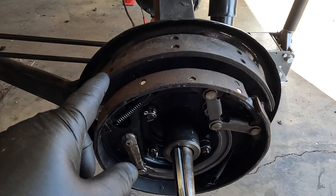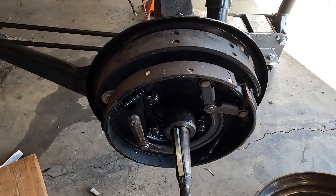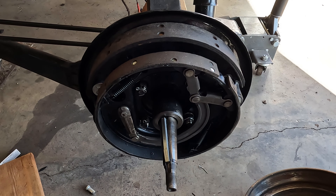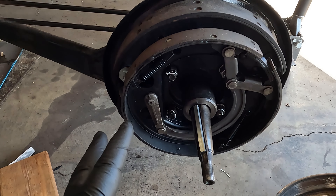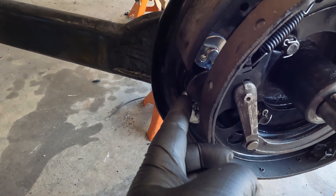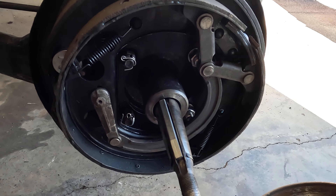Like the front brakes, I picked these up at a swap meet for 10 bucks a pair. They're the same type of lining I put on the front. I went over to our local clutch place, brought over the emergency brake band, and had them reline it. The assembly goes together just like the front brake, so there's no need in being redundant. Back here there's an adjusting wedge, and the rear rollers ride right on that adjusting wedge — otherwise they pretty much go on the same.